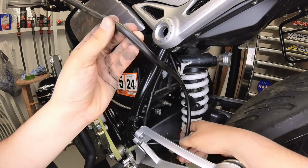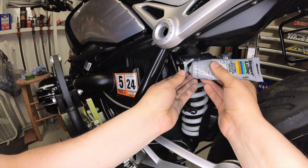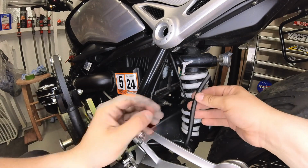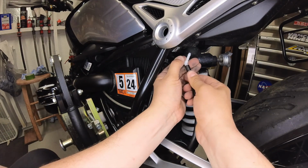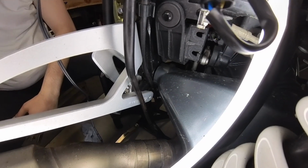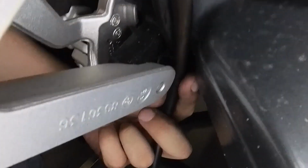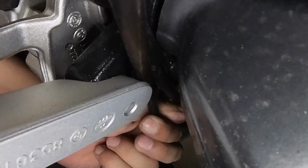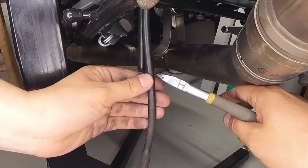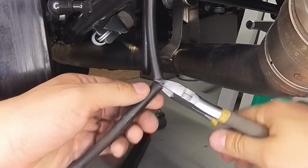And to continue with the line, this is where we will be reusing the hose from the throttle body. Connect the line to the Y connector and insert it to the existing clips where the lower hose was attached. Once the hose is secure, cut it at the same length as the overflow line from the gas tank.